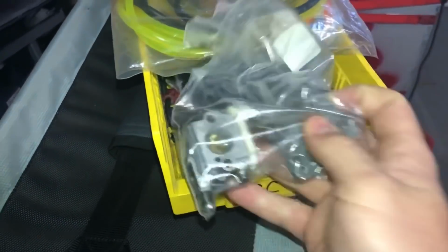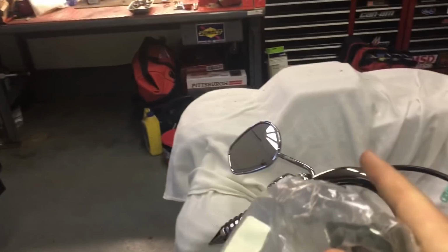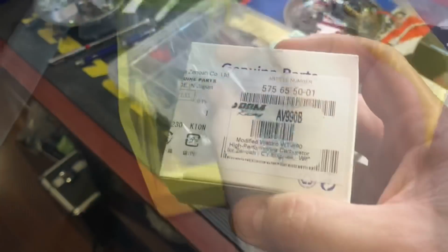All right, it will make your engine breathe well, especially if you're bashing. If you're just out there bashing in dirt, if you're not out there drag racing, needing and wanting that extra air and fuel flow, just go with stock 990 carburetors. It's already a performance carburetor. You understand? So don't be changing those springs for no reason.